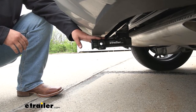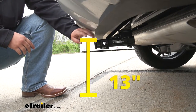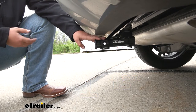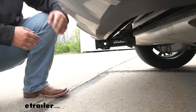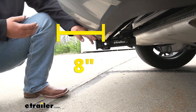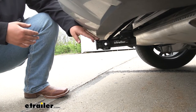I can give you some measurements to help you understand where this hitch is going to sit on the back of your Seltos. From the ground to the top part of our receiver tube opening, it's going to be about 13 inches — very important for ground clearance and determining if your ball needs to be in the rise or lower position. From the center of our pin hole to the outermost part of our fascia is going to be about eight inches, so keep in mind when selecting folding accessories that they won't fold up and hit the back of your fascia.